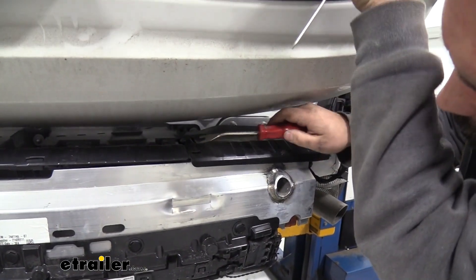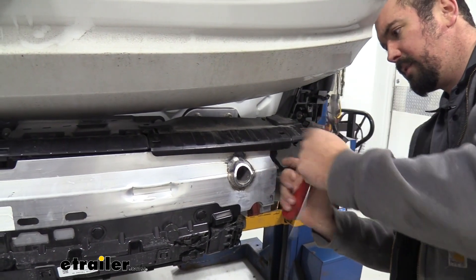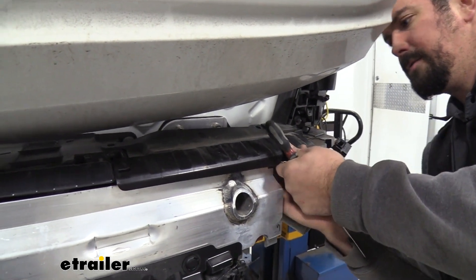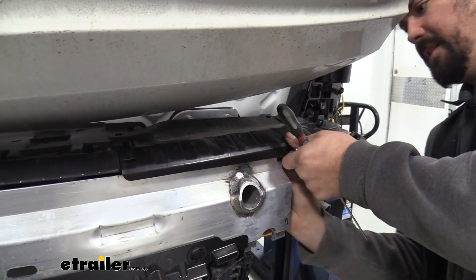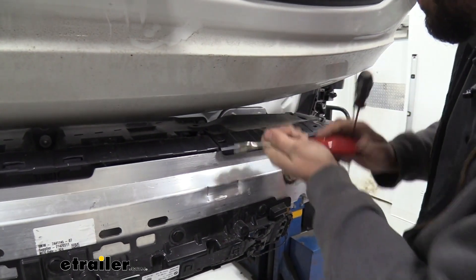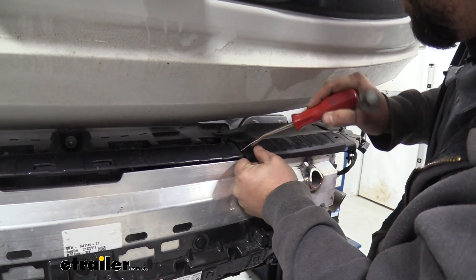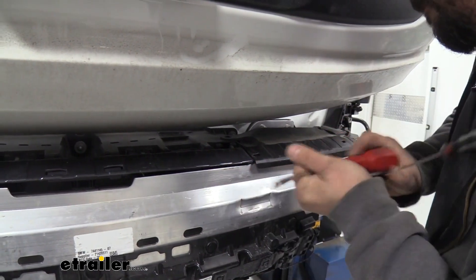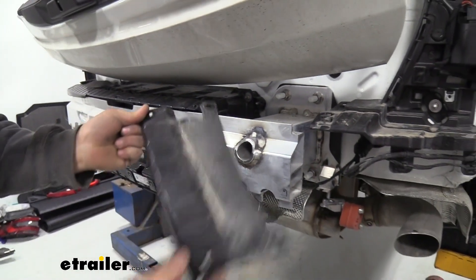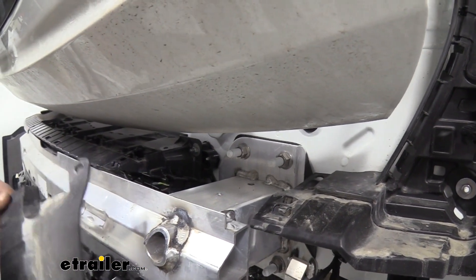You may have to move your tailgate a bit to get a little more access. These tabs are pretty simple — you can probably get them on the bottom side here. I'm just pushing these towards the tight fit, but you can kind of just push the tab back — you can probably do it from the top as well, using your flathead or trim tool. Wedge that in there, align that clip to push back and unlatch. With a little bit of force we'll be able to get that out — there's actually a back clip too, so it's kind of tricky. Just pry this up and it should work its way out. Repeat the same process on the other side.